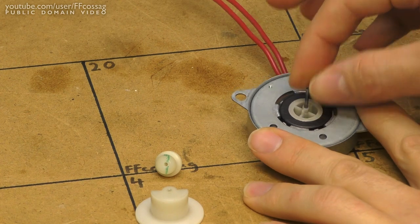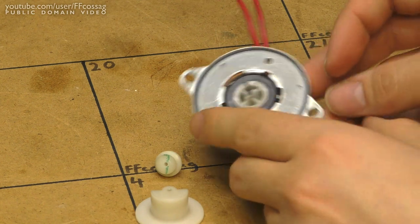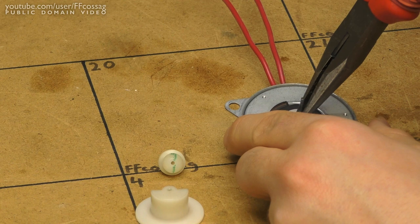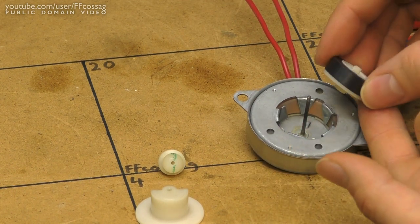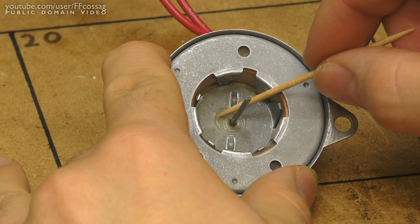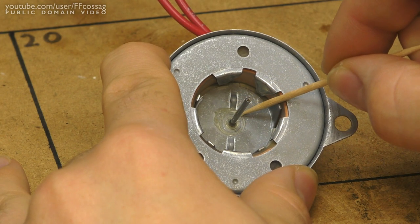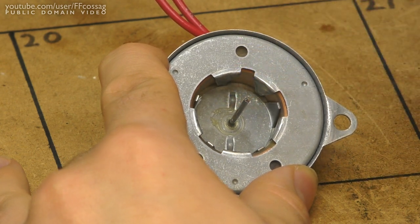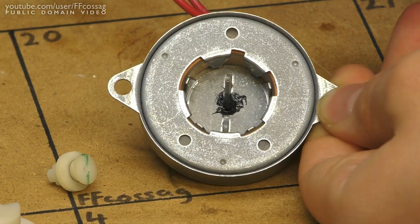I was wondering why I couldn't just lift the entire mechanism out, and why the axle wasn't turning around the bottom of this thing. Well, it turns out the bearing assembly is actually around that axle. And that's a little permanent magnet. And I must say that for being 30 years old, this grease, aside from being in the entirely wrong place, is surprisingly fresh. It hasn't turned into horrible gunk, it's just pretty much good. But there's always room for some molybdenum disulfide.